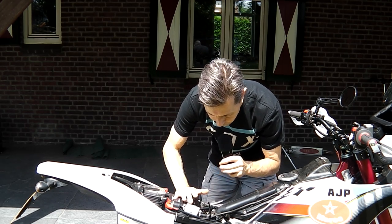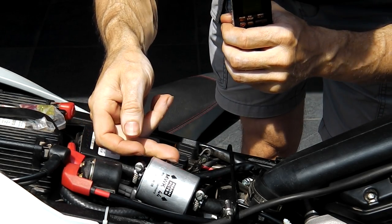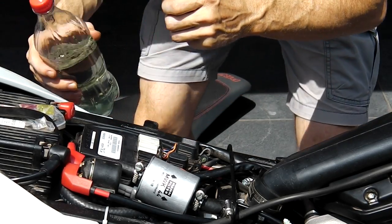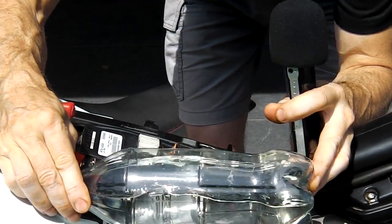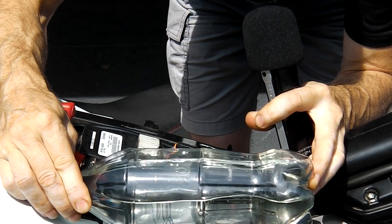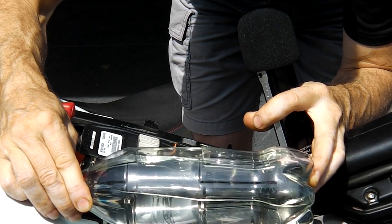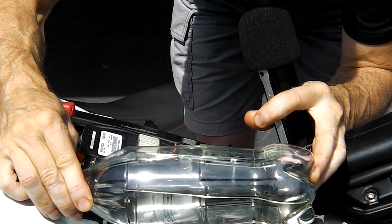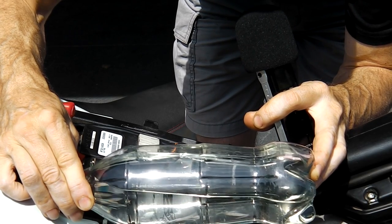Here we have the fuel filter. It's laying horizontally. The fuel filter may have some air on top — unfortunately you cannot see it. Let me demonstrate that by taking this bottle of water. If this is your fuel filter, fuel will flow from one side to the other, but the air bubble stays, and that's not a good thing. If the engine gets hot and the air gets warm, it will expand and may cause the engine to cut off. And that's really a bad thing.